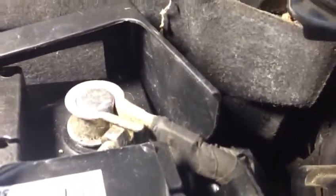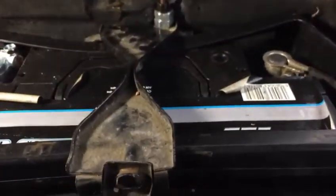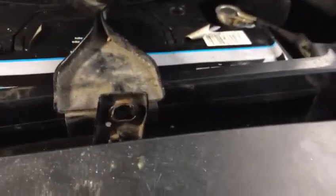And the negative after that. That's the negative side. So when you finish, you can have that — any oil, Vaseline, petroleum jelly, whatever you call it. You've got this battery terminal grease spray on it, like that. And the other side. What it does is avoid this corrosion again.